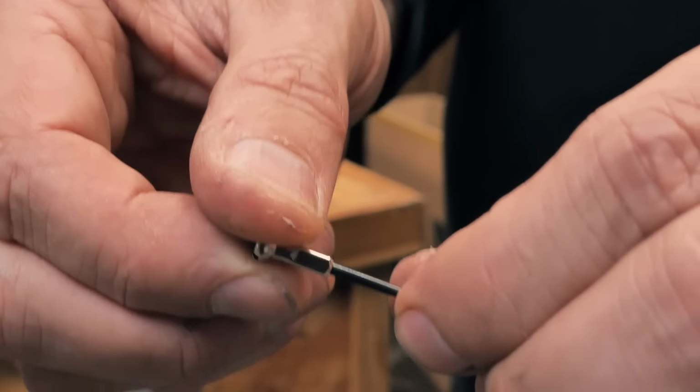And if they're not equal, what it will mean is that, let's say we have these 3 spokes here. These 2 little bad boys could be really, really tight, and this one's having a right lazy time of it, not doing any work at all. If that's the case, this one will start to shake itself loose, and these 2 will have to take even more load to try and keep the wheel true again, and that's when you end up with broken nipples, etc. So what we're trying to do is make sure that all of the spokes are sharing the forces nice and evenly. And then of course there's that whole aspect of being within all the safety parameters.